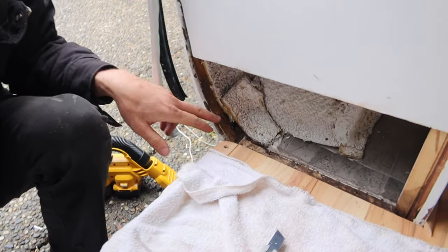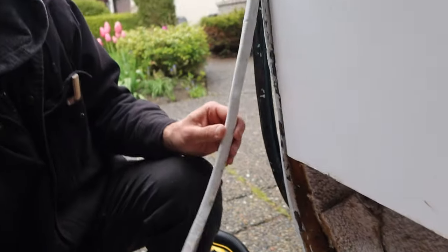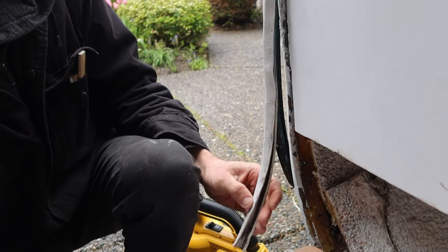Putting that door in, I was looking down at the floor and looking at this place that I had kind of looked at before and cut out a little bit of rot, and I was just like, I don't know. So I started to cut some more. I cut a big piece out of here that was all rotten, and somehow the water is collecting in there. And I think what is happening is the water is actually running down the door jamb and in through here, collecting down this corner, and it's rotting out the wood that was in there. So what I've done is I've actually drilled a hole right down at the bottom of the corner, and then I'm gonna put new wood in there, and also this stuff here I'm going to seal up on the outside so the water can't get in here and run down it. I think that might also be what's happening. So yeah, I just love chasing rot.